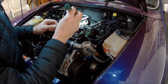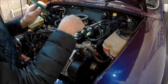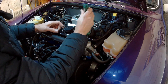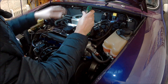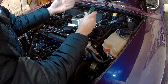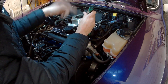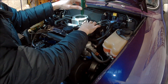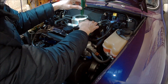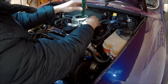So yeah, on full throttle in the car that's still opening 90 degrees on the throttle flap, so that's fine. I might take the cable out and try to get some lubricating oil down inside the cable and leave it for a little bit of soaking. A little tip: these late MPI minis from factory setting, a lot of them never gave full throttle. If you put them on full throttle and look at the throttle flap, it's only open about 80 degrees — not fully open vertical.